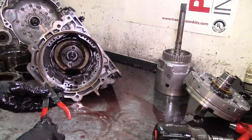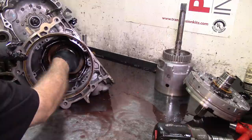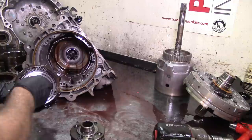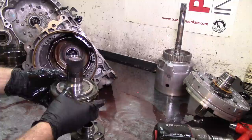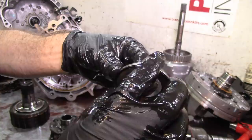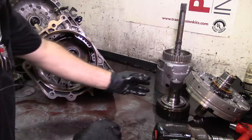I think these are the PRT-15 pliers from Snap-on - Mac and Matco have them too, but I think Snap-on went to a Blue Point version. Taking the output shaft snap ring - sometimes it's hard to get out and sometimes they fly away, just like that. No big deal, that comes in the kit. 2004 and up, it's a bearing-type front planet, and the front planet bearing has a fluid dam - a fold right here. Once I take the rear planet out I'll show you the comparison.